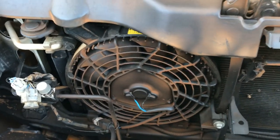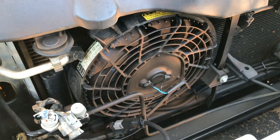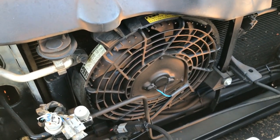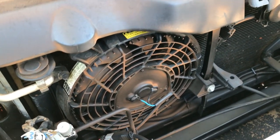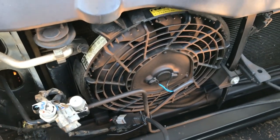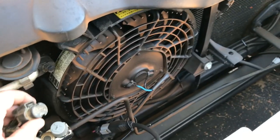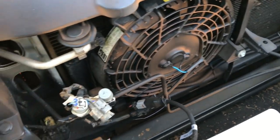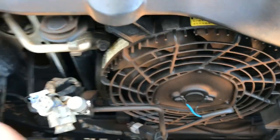The other mod I've done is the air conditioning fan. On the GXL, up to I believe 2007, it didn't come with this fan — only the Grande did. You can buy these off eBay for around $50 to $150; I managed to score this one for about 50 bucks delivered. You could put a standard thermo on there, but I like the fact it just bolts straight on. Under this cap here you need to jump two pins — there's some tutorials on the internet; I'll try and find the link and put it in the description. Then it just plugs straight in for this plug down the back here.